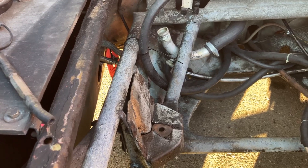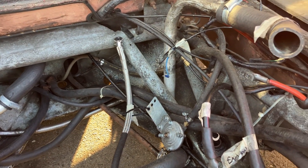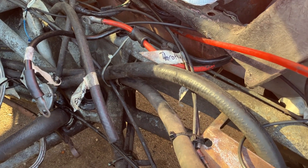I'm pleased to have got that fuel tank breather pipe done — it's a small job but quite a vital one. The pipework that was in there was brittle and disconnected in places so it obviously wasn't doing its job. I've got quite a lot more to do in the engine bay — various hoses to change, all the ducting to put back in, maybe paint the chassis to get it looking nicer, replace the silver foil heat shield, and a bunch of other stuff. I hope you'll join me again next time when I get a few more jobs done — thanks for watching, bye bye.